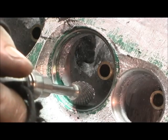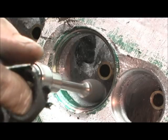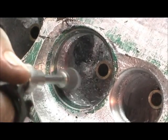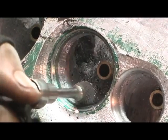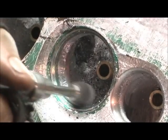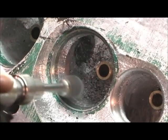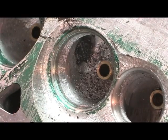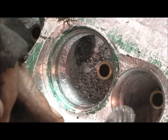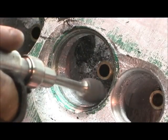So let's go in here and cut on this iron seat and see what we can do. I'm coming at about 12 or 13 degrees inwards from the valve seat. Keep in mind, I'm not cutting the aluminum — I'm cutting the actual iron seat itself.